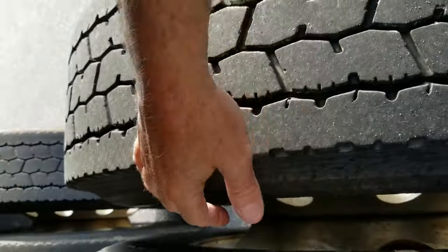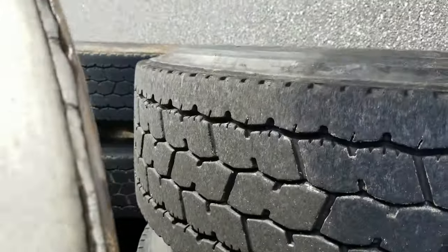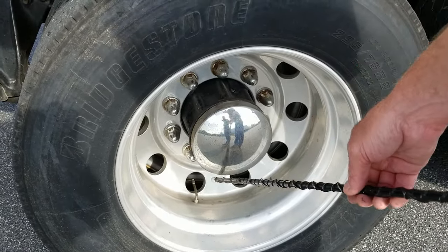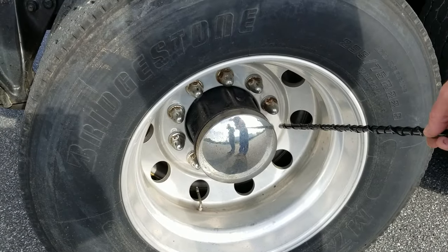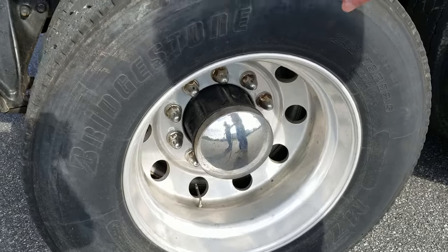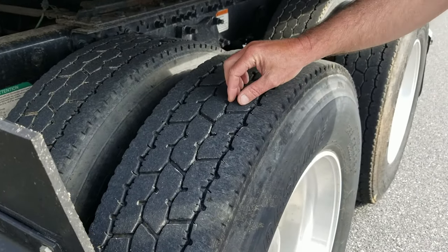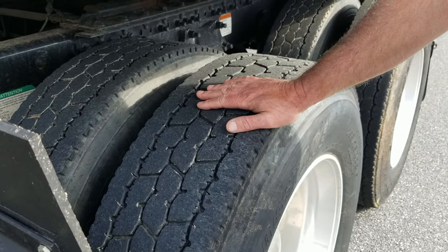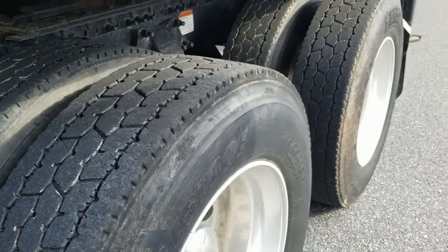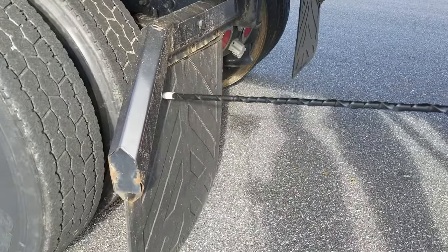I will check my wheel assembly. First thing I want to check is my spacing, make sure there's no obstruction and the tires aren't touching. I want to check my rims — these are bud rims — make sure there's no cracks, holes, illegal welds or damage. I want to check my lug nuts, make sure they're all there, they're tight, no rust trails or shiny threads that may indicate a loose nut. I want to check my axle seal to make sure there's no signs of leaks. I want to check my tires — all four sidewalls — no cuts, rips or bulges, even wear, no mismatched tires, no tread separation, at least two thirty-seconds of tread. I'd check air pressure with the air gauge; it should be 100 to 110. I want to check my mud flap to make sure it is securely mounted, no loose or missing bolts, and no damage.